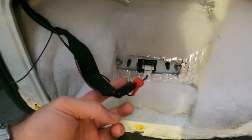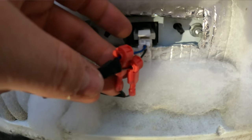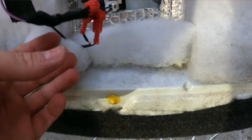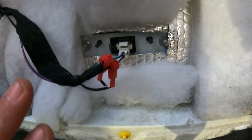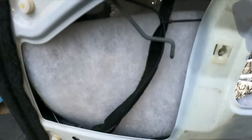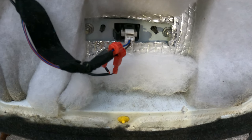Right, so it's done. I used the scotch locks that actually came with the wireless camera, and as you can see it literally just clips on around the factory wires for the number plate light, and the camera has just plugged in using spade connectors directly into that. I haven't actually bought anything extra — just used standard wire cutters and some cable ties to hold the wire, and the camera's working absolutely fine.